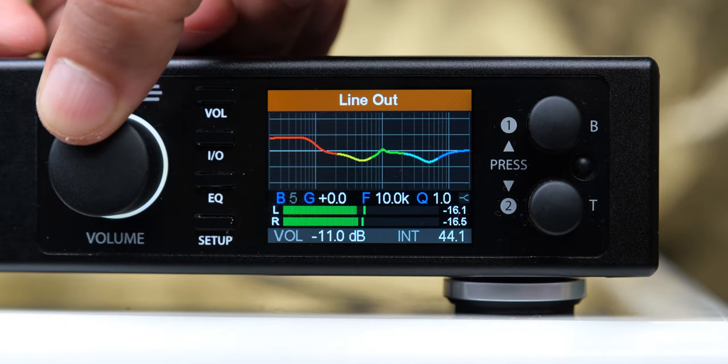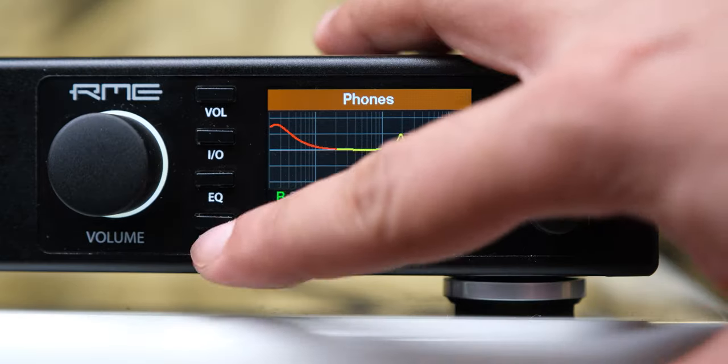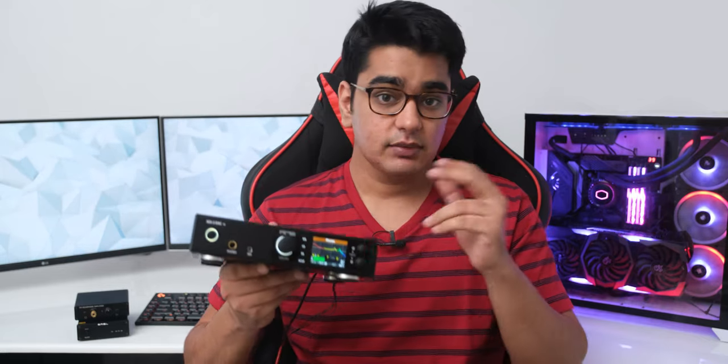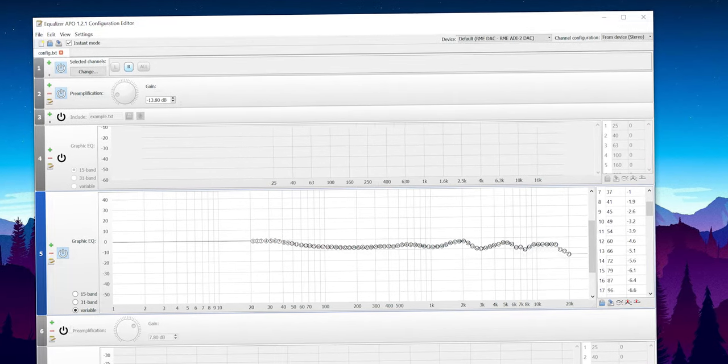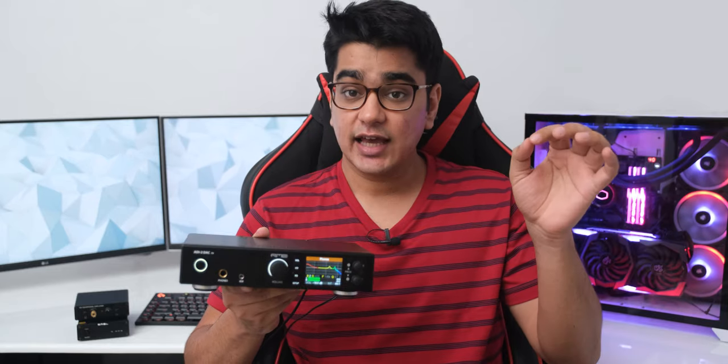All the different outputs on the RME DAC can have their own equalizer settings — so you can have the EQ enabled only on the headphone out, with different EQs for IEMs, headphones, and speakers. This is a game-changing feature, because combined with the ability to change channel balance for studio monitors, the RME DAC completely eliminates the need for Equalizer APO software. It is actually even better than Equalizer APO, because previously I had to disable or enable different filters whenever I switched between headphones and speakers, but with the RME DAC you apply different EQ settings specific to whichever output is selected — no manual switching needed.